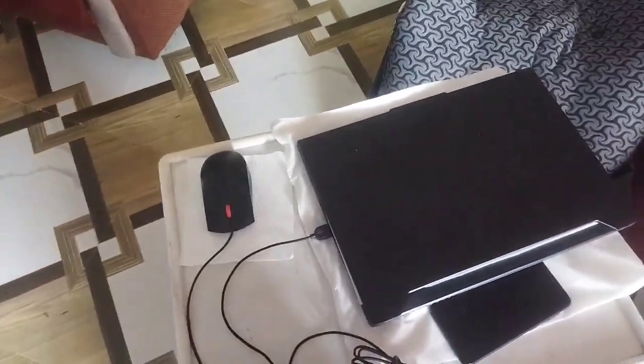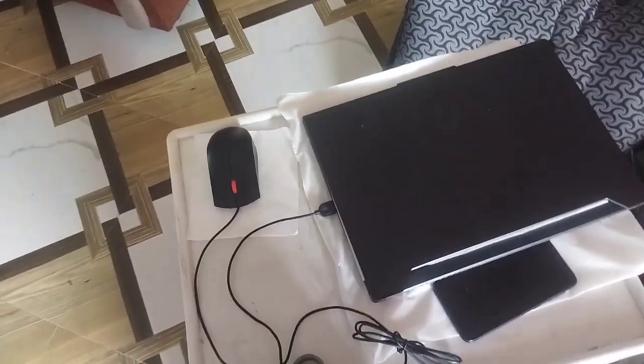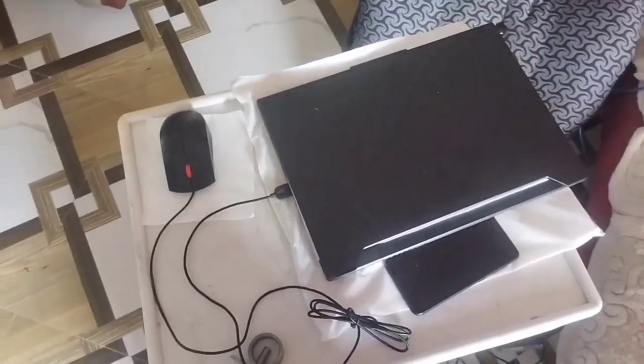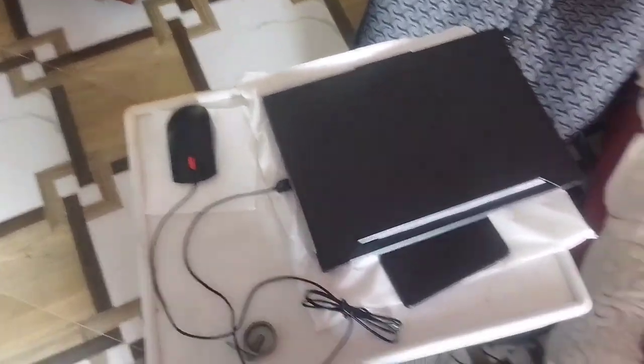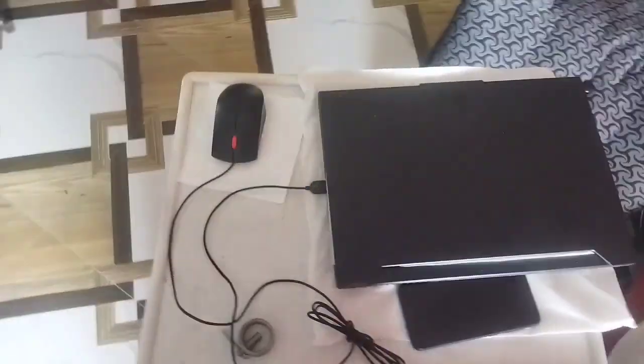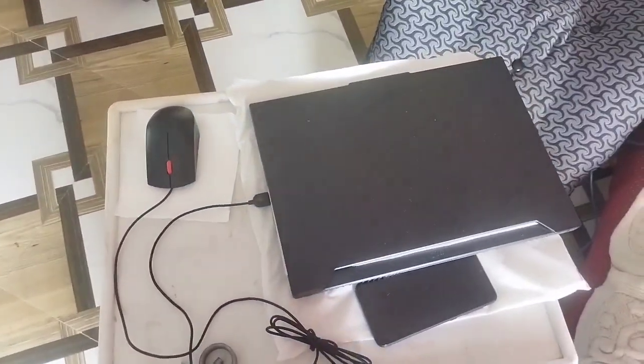All right. So after this setup, I will help you in exactly configuring the extender within the secondary router. Now I'm going to log into the secondary router's IP address. I will log in to the router's console, and I will show you what changes are necessary to help that secondary router act as an extender. So let's look into that, guys.